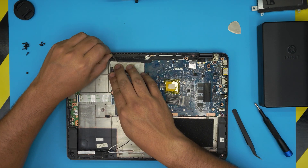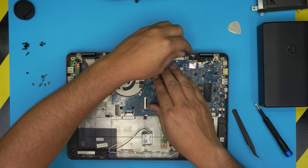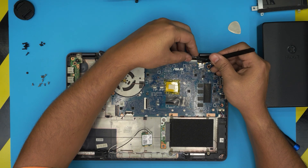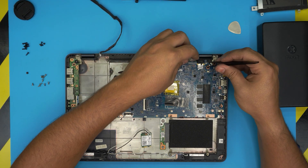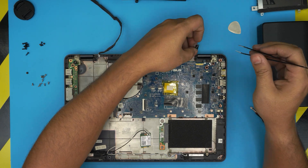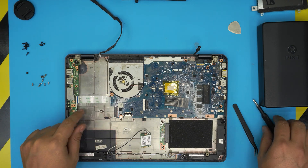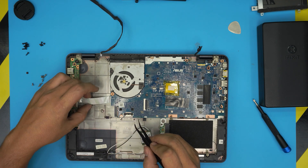Remove the flex cable for the LCD — it has a little adhesive, so just lift it up and bring it over. For the touchscreen, lift the paper covering and pull out the jack from the sides — don't yank on the cable, just pull from the corner with your nail. For the LCD connector, lift the cover and pull back the jack. Then disconnect the speaker cable by pulling it out. For the remaining flex cable that runs underneath, lift up the jack and pull it out.